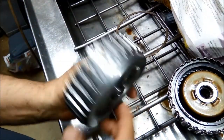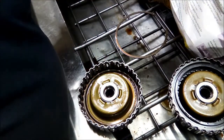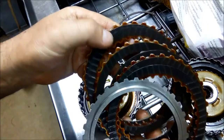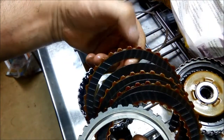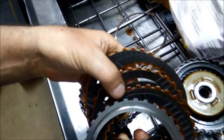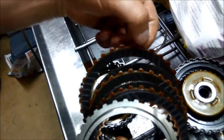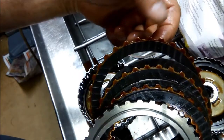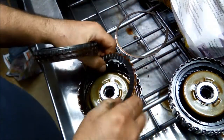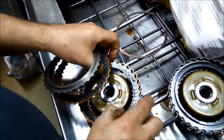We've got another drum and it's got a molded piston there. I've just soaked all these — they're actually one-sided clutch plates, so the teeth will be on the outside on one and on the inside on the other. You can actually replace these with standard clutch plates. The plates with the outside teeth are usually the steel ones and the inside teeth are the friction ones. Just remember to soak them in oil before you put them in.